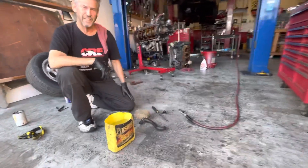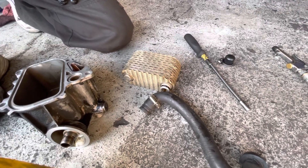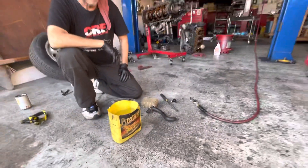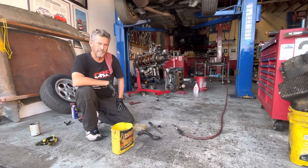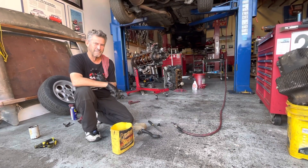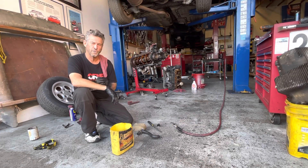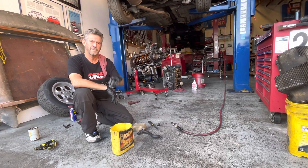We've got what looks like an oil cooler seal failure. A lot of times this failure is misdiagnosed as a head gasket, and there's only one small port in the cylinder head that can leak oil into the coolant — the passage with a check valve that goes up from the cylinder head to the cam housing. It's really rare to get a head gasket failure causing an oil cooler seal symptom on a 944. We're talking about oil in the coolant, what we call milkshake.